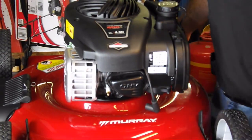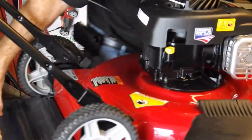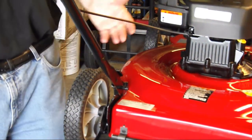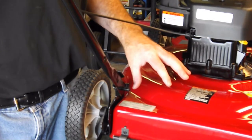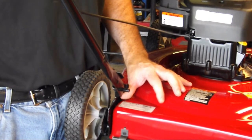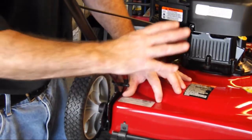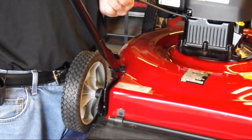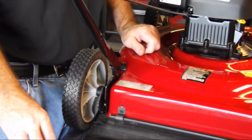The other number that's very important is on the actual item that you are repairing, whether it be a log splitter or a generator, or in this case a lawnmower. They all, on the chassis of that unit, will have another manufacturer's label, and that number will correspond to items not related to the engine. That would be like handles and cables, wheels, those kinds of items.